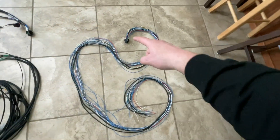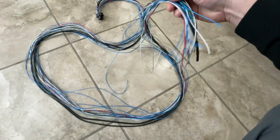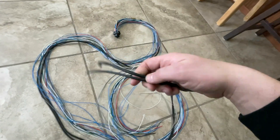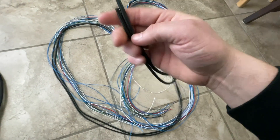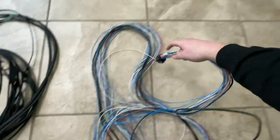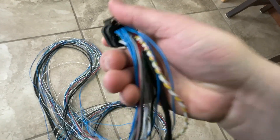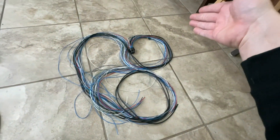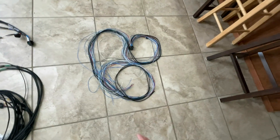Your unterminated harness is about 100 bucks and it comes with — like I've said before — basically 400 feet of wire. You terminate all this stuff yourself. The nice thing about it is you can custom-tailor it to your application if you're building something from scratch and you have the time and the skill set. I don't have either of those. It comes with shielded wiring for cam and crank, and the back of the main connector is populated with color-coded wires matching your wiring harness diagram. But if you watched the last Civic episode, you know I abandoned that in five seconds.